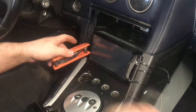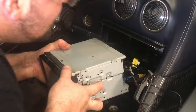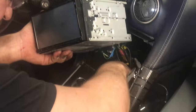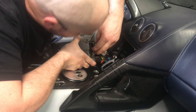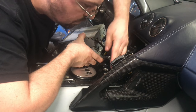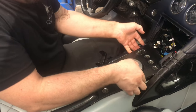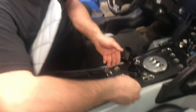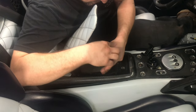Let's get started. So that one's on the right. Now basically there's a bunch of little lock tabs on the bottom of here, and I've essentially just kind of popped it up. I think there's two legs under here as well, so we may have to take out this little insert and see if we can cheat this up just a tiny bit so we can get that to pop up and come out. We'll use a T25 Torx bit to undo the five screws that are holding this insert in the center console.